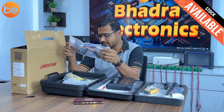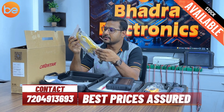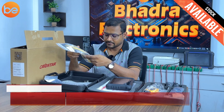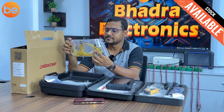The same signals — CAN low, CAN high, supply, ground, ignition, K-line. There is no difference apart from this cable. Next are the jumper cables. Using these jumper cables you can connect easily — they come with female sockets so you can connect to the ECM coupler easily. The quality is very good. I've never seen this type of quality in the market — this product is really good.